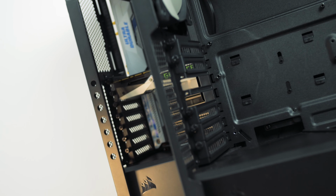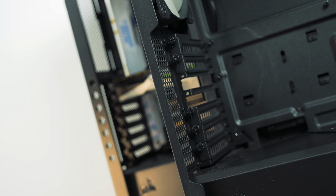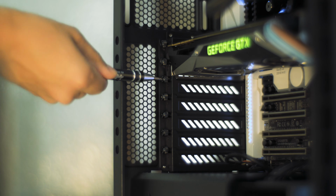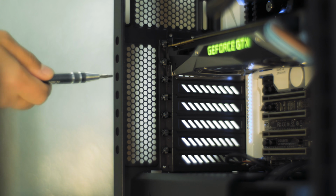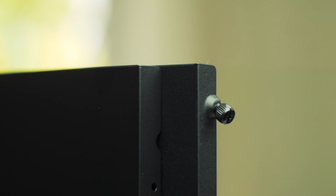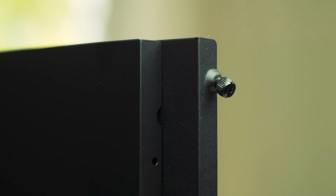First, the frame around the PCI slots is now closed off, unlike on the 400C where the frame would accommodate a screwdriver being used without any issues, which unfortunately is now changed with holes that are less convenient to use. And the second thing, the rear side panel no longer has the self-catching screws. It's a weird omission that should not have been changed.